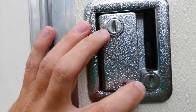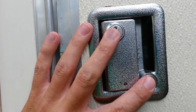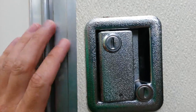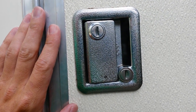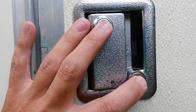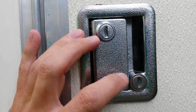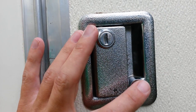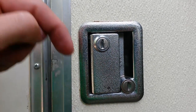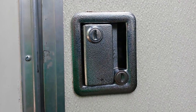So what I'd recommend doing is clicking in the description below for a link to get a new keyed lock set. They'll give you a new key with two tumblers that doesn't have a master handle lock set for it. Also, any really good locksmith will be able to re-key the tumbler. They can probably just modify your existing key and your existing tumblers so that the key is different than the master keys. That's another option as well. But I would recommend ordering a new lock set. You can replace those, and then you'll have a completely secure lock handle.